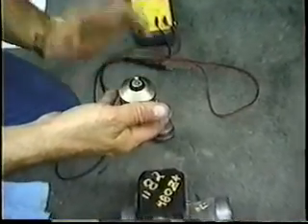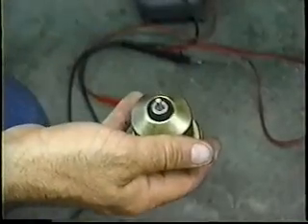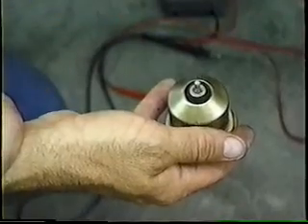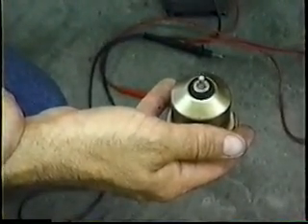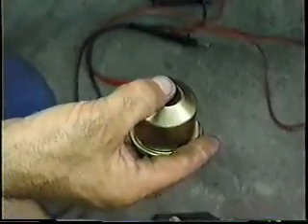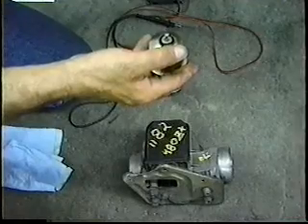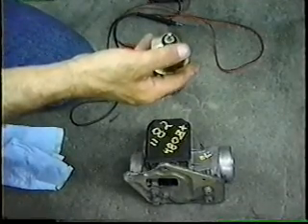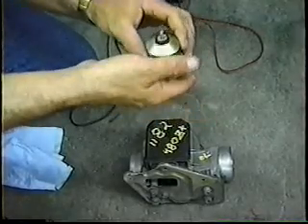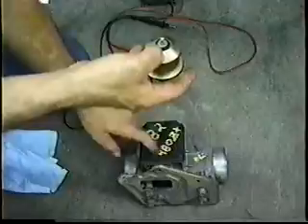So if you've got this style, that ground contact does the job for you. If your fuel pump won't kick on and everything else is working, simply disconnect this and retest it — the fuel pump should run on the sensor switch. If in doubt, disconnect this switch and pull it off; the fuel pump should then start up and run. That's the switch with two pins, not the single bayonet fitting. If you've got a five pin, simply disconnect the oil pressure switch, and with the key off, pull the plastic connector off the back of the alternator, because it also uses the IN terminal of the alternator to close the relay on the double control relays. So on the five-pin cars, the system senses both alternator output and oil pressure to get the fuel pump to run.